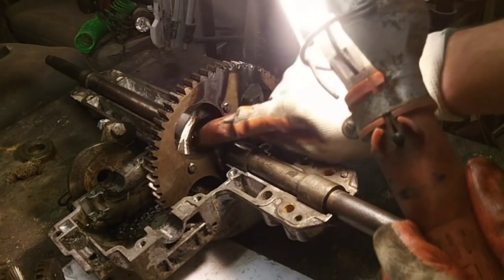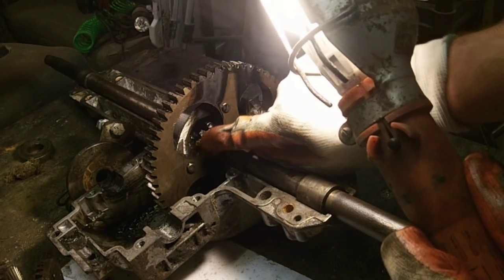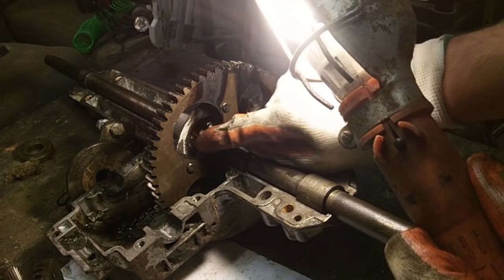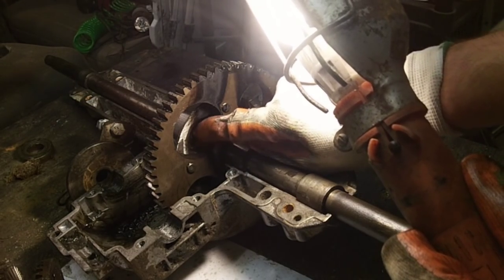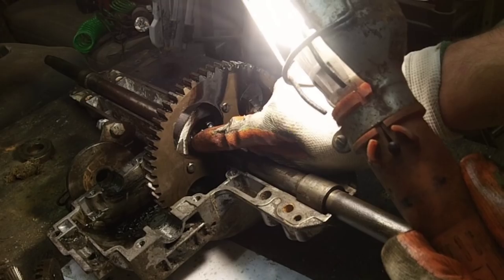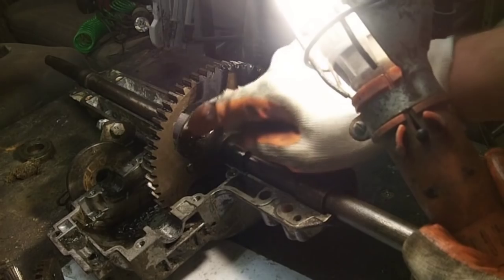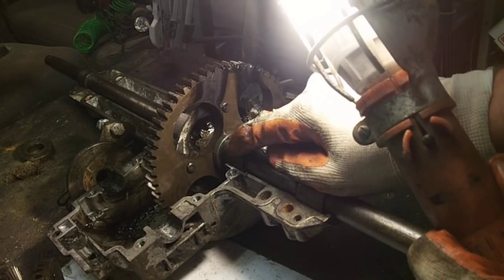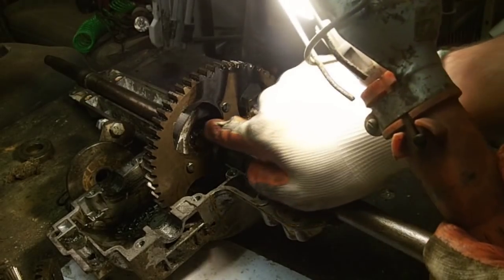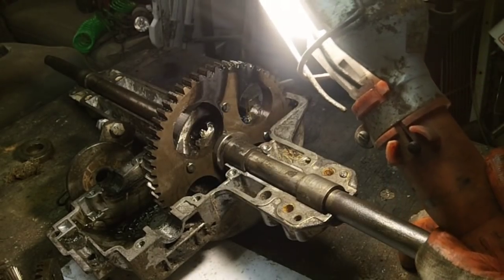At this point, the next step is right here where you can actually see on that side the spider gear coming over, and that's the axle gear. What I'm going to do is go welding back and forth across the two, making sure to bind it as good as I can directly to the outside of this differential cover. Then I'm going to flip it over 180 degrees, do that side, and then go back crisscross and fill them in accordingly. I'm also going to see if I can weld this directly to the inside of this gear here. Every little bit helps.